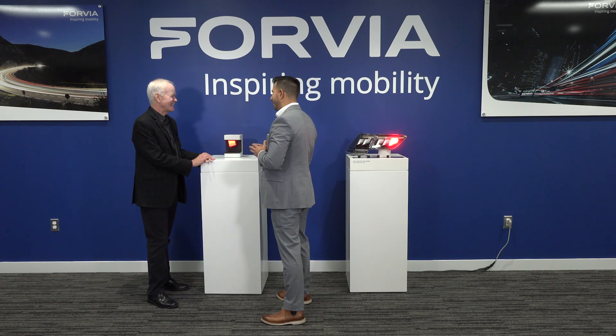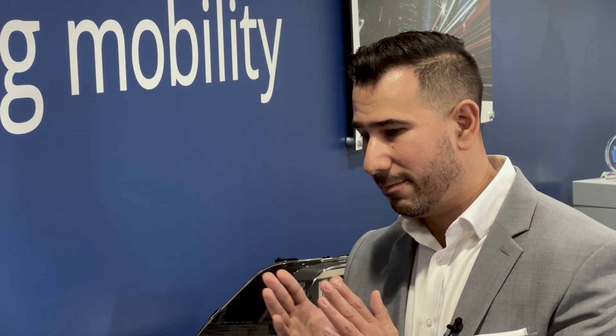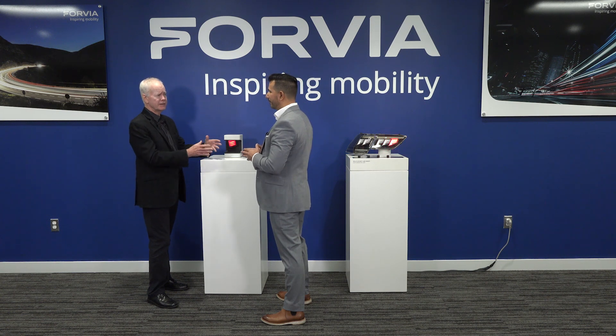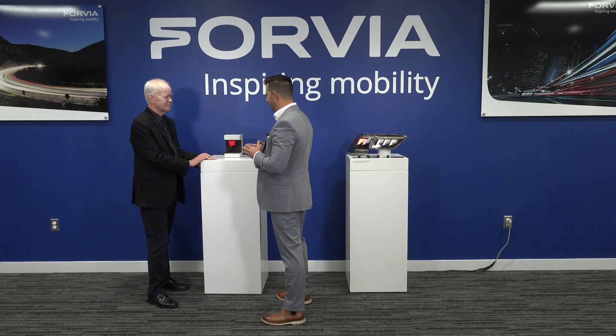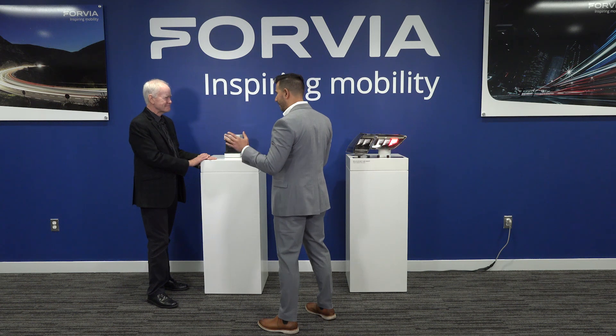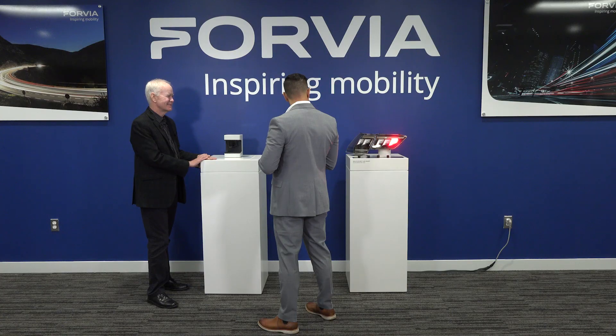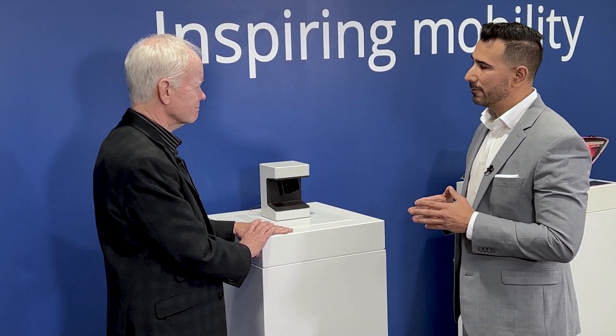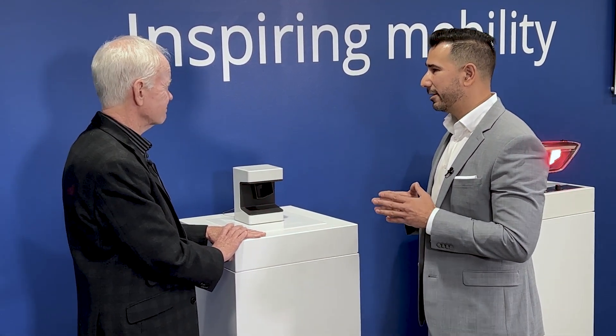That five-millimeter number really stands out. It's a great accomplishment from our engineering department to have this very compact, slim system, which provides flexibility and very thin packaging space. And with that comes mass and weight reduction, and power consumption benefits — especially important as we get into electric cars and even ICE cars with all the electronic technology. One watt — that's all you need for tail function. And 10 watts for stop function, which is also very efficient.